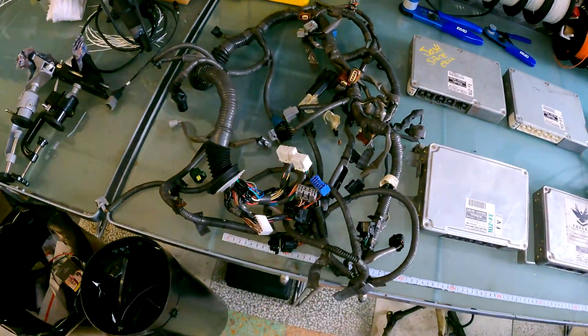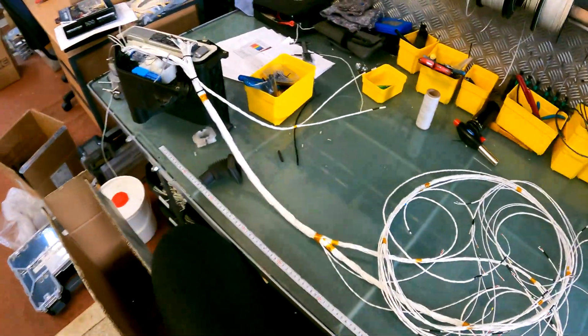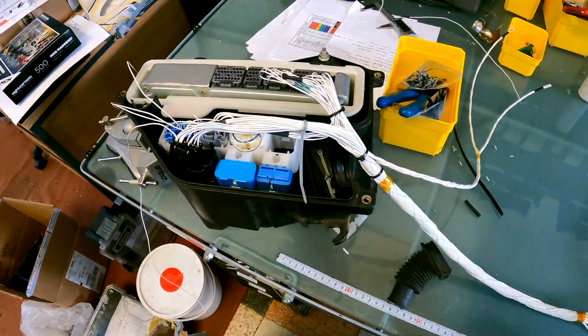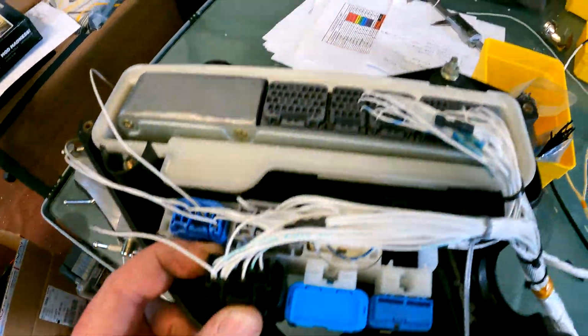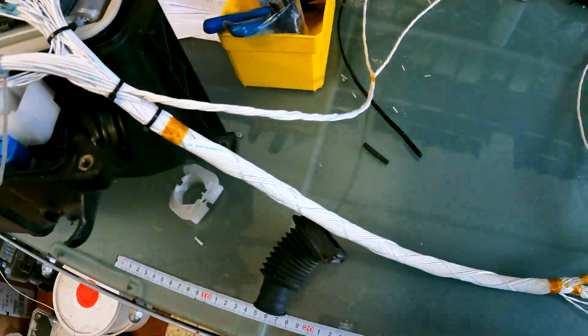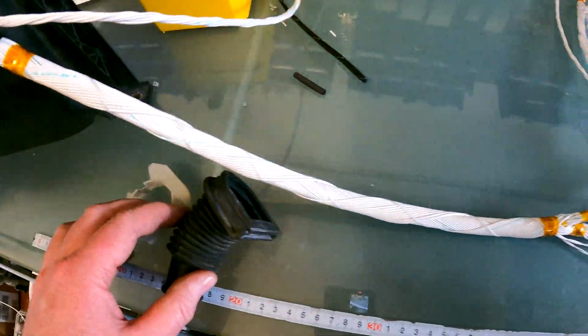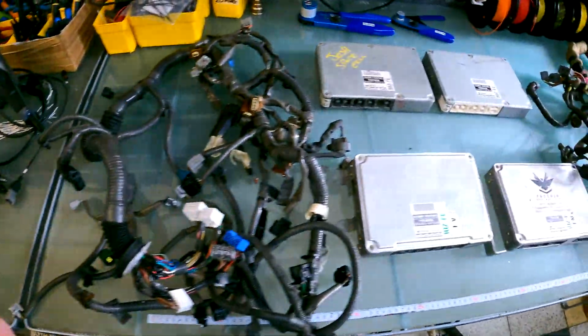All right. And then just to give you a sneak peek, this is a 1UZ non-VVTi being built into an IS200 plug and play. So you can see we're putting all the plugs in there, all brand new wire. We're deep-pinning all of these to come with your harness and going from there. And there's a little grommet that we'll throw over when it's finished being done. All right, so that one's just nearly done, just needs the heat shrink put on it.